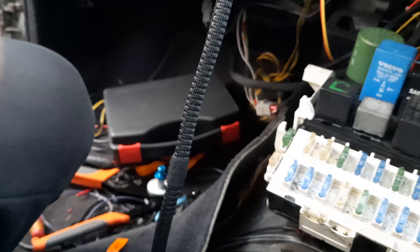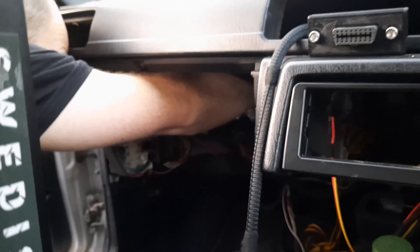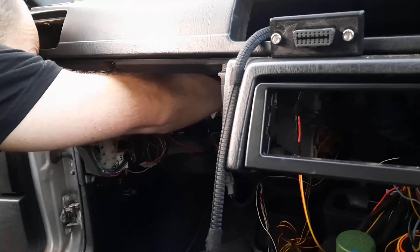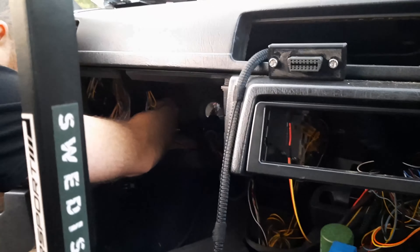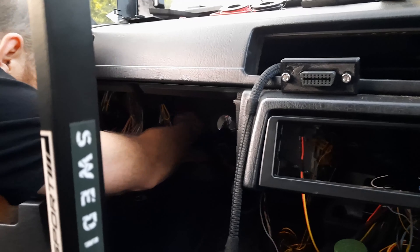Put your hand on the main relay, just check all the relays are triggering. Are you ready? Right, I'm going to go now. Yeah, that clicked. Right, I'll start again. That one definitely clicked off again - the main relay? Yeah. That's all three. That fuel pump is loud. I don't want to burn the pump. It should be fine. It will click in. That fuel pump - it only goes for a second as well, which is what it's supposed to do.